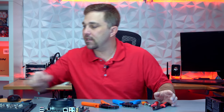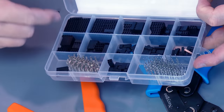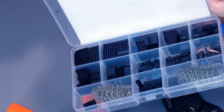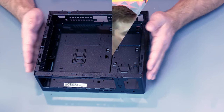For supplies, you'll need female ATX connectors for our 24-pin and 8-pin EPS cables, and some female DuPont connectors used for the front panels. I also have an assortment of DuPont housings and an assortment of heat shrink. I'll leave links to all this stuff in the description below.